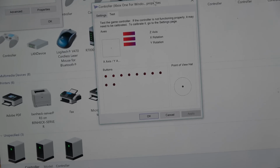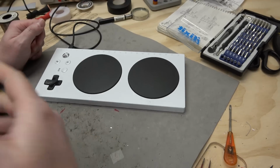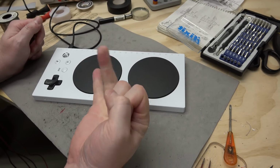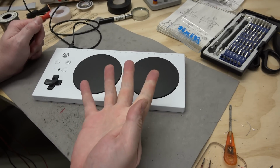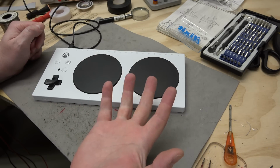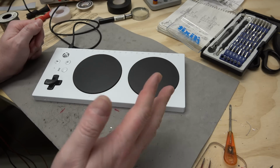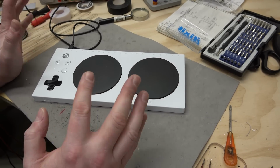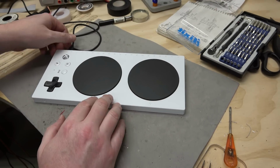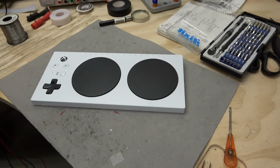The controller is active. Like if I push these buttons, I can see things. All you need for an analog stick, as far as plugs, is a voltage reference, then ground, X, and Y. Maybe the reason they didn't port it out was because having a voltage reference and ground would be a possibility to short out the system, and they didn't want that. I don't know. But it just seems overly complicated to make people use the analog sticks that way. Well, you know what? We can come back to that. How about, for now, let's take it apart.